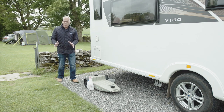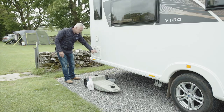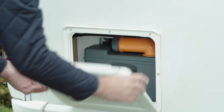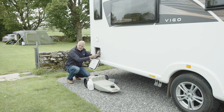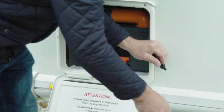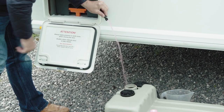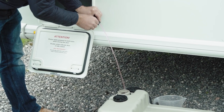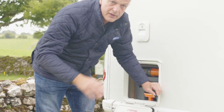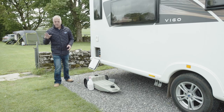If you're ready to travel home or you're winterizing your caravan and don't want water in the flush, there's a drain pipe just inside this door. On this caravan it's a black pipe to the right-hand side with a bung in the end. I've got my Waste Master here to empty into. Pull the bung out and empty the flush liquid until it stops running — when it's empty the flush is completely drained and you're ready to go.